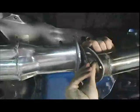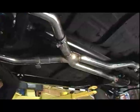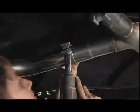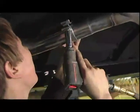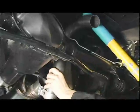Being on a lift, it's easy to do. What you want to do is get these things worked in place and use the clamps to tighten them snug, then walk away from it and eyeball it to see that they're hanging evenly and in the right place — that they look good and you don't have one side hanging lower than the other. When you're happy with the way they're in place, you can start to snug everything down a little bit more, then move on to the tailpipes.